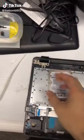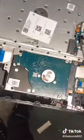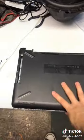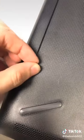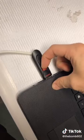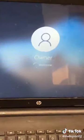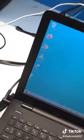This is the HP laptop from about three days ago - it had the failing hard drive, so we're swapping it out. This is a brand new 7200 RPM hard drive versus the 5400 RPM that was in the original laptop. I'm going to go ahead and screw it all back together because I know that drive is going to work. It's my birthday today. I'm going to put in my automated, updated Windows installer - it's going to install the OS right off the bat. I put it in, walk away, and we have an operating system.